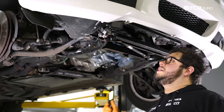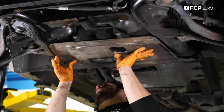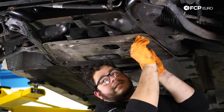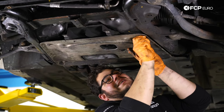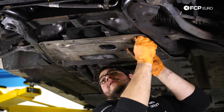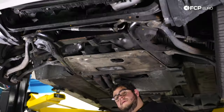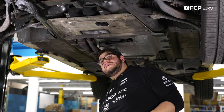We're going to do two things before heading back up top: put the skid plate back in — that's four 16mm bolts — and reinstall the splash shield with the 11 8mm bolts. One rule of thumb: never drive the vehicle without the skid plate because it's a structural piece and everything might shift on you, making it impossible to get back on.